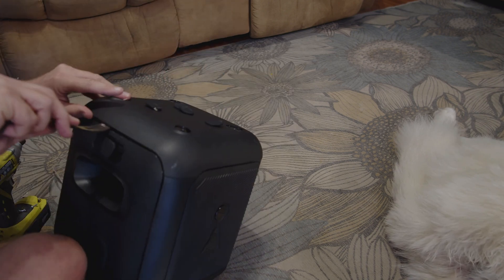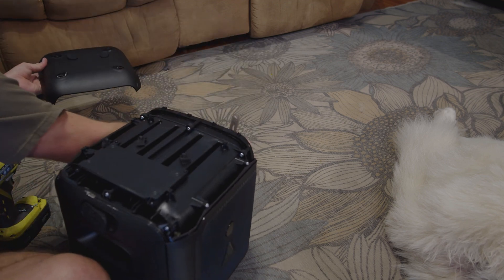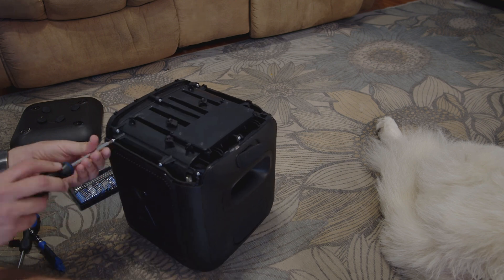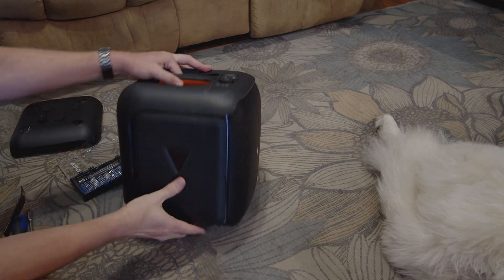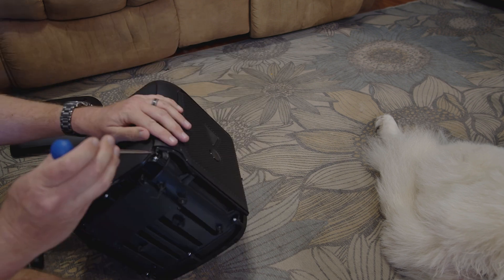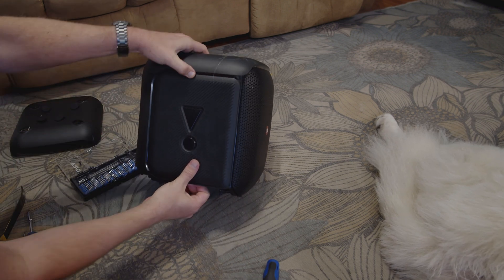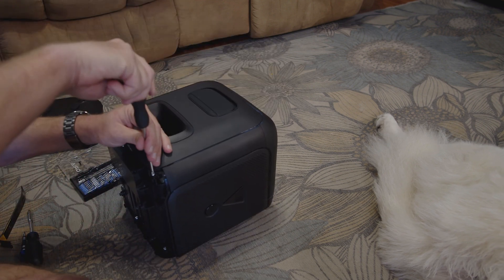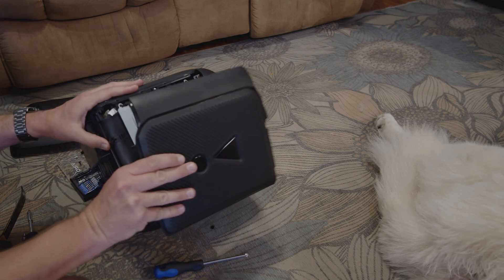After that is a little bit of a pry job. Once we have the bottom off, all we need to do is remove the right side panel. Immediately I see these two screws at the bottom, so off they come. The panel doesn't slide, so let's find other screws. There is one on the bottom rear. It still doesn't slide, and it turns out there is a screw that holds the rear on but also gets in the way of the side panel sliding down. So we remove that, slide the panel, and lift it out.